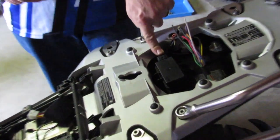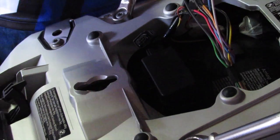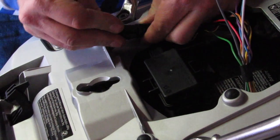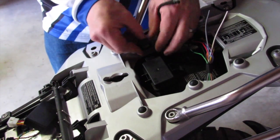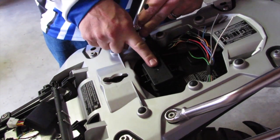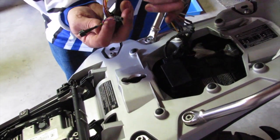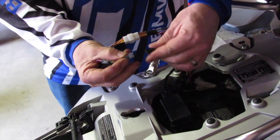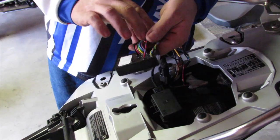The smart switch is only connected directly to the battery, and it plugs in onto your bike's CAN bus — this little connector here. What we're going to do is remove it from the tire pressure sensor, take the little inline cable, plug the female end in there, and plug the original connector back in. So the bike's CAN harness still goes directly to the tire pressure monitoring system — we are just listening in on the CAN bus. The smart switch itself gets connected to the main harness, and the CAN harness plugs in here. The little programming cable will be used if we want to make changes to the rules.